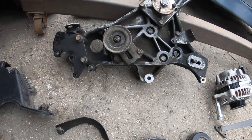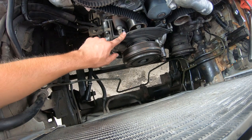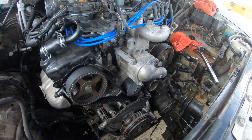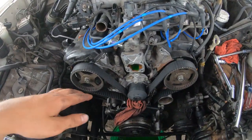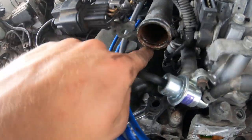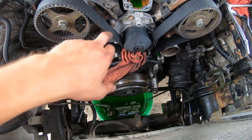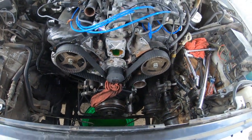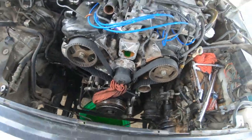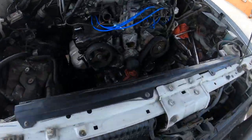I'm probably just going to loosen the crank bolt, pop this cover off, then loosen the tensioner and take the belt off, then take the water pump off — it's pretty straightforward. I got the pipe off that connects to the back and goes to the water pump, so you'll need a new o-ring there. This pipe is super rusted so I might get a new one. To get the pipe off, take four long bolts that connect to the thermostat right there.